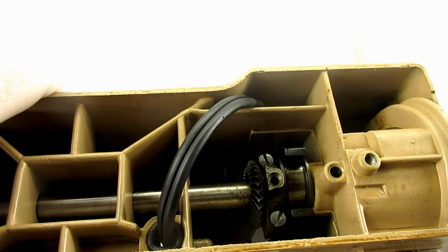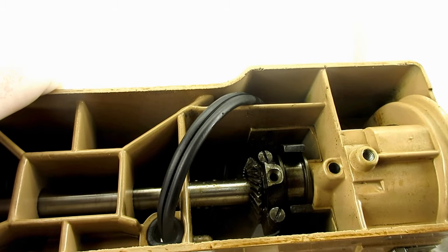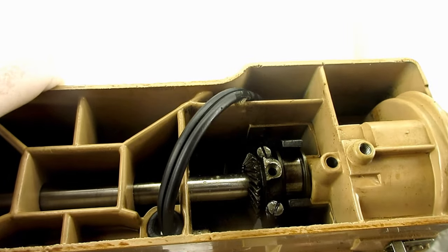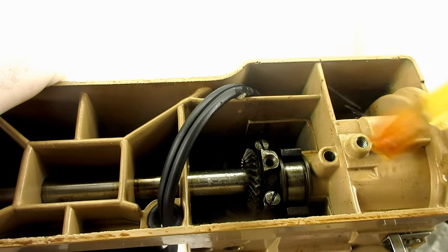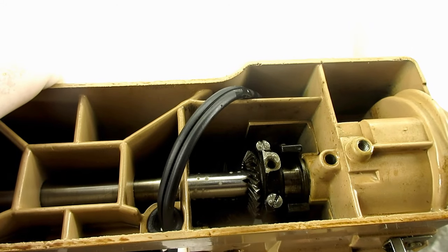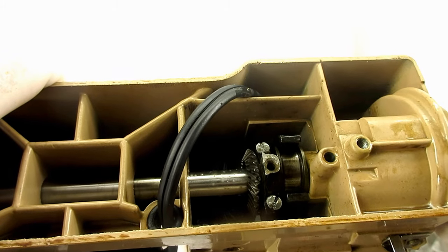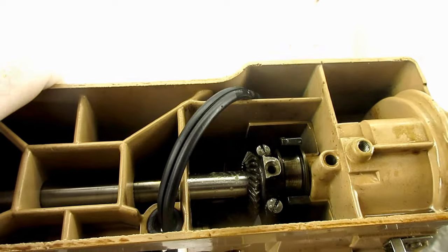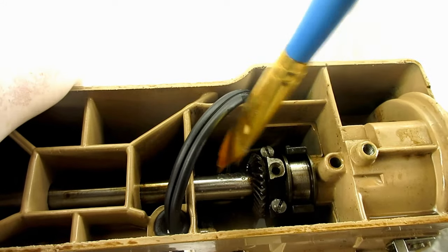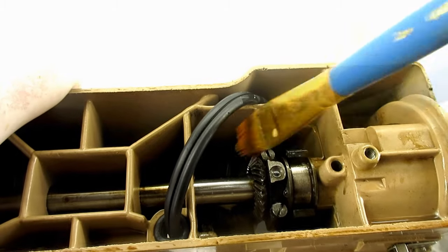Usually on the gears, I almost always use 100% solution. So I'm gonna kind of slather that on there, and I want to get it for sure onto that lower gear, because I couldn't brush it as much. So I'll put some on here, these parts. Now, you might get to some point here where the machine freezes up, because we're taking everything off of the gears, right? And some of the bushings and stuff too. So don't be surprised if all of a sudden nothing turns. And we'll fix that when we oil and stuff, but don't let it scare you.